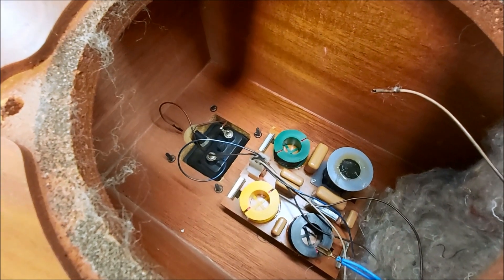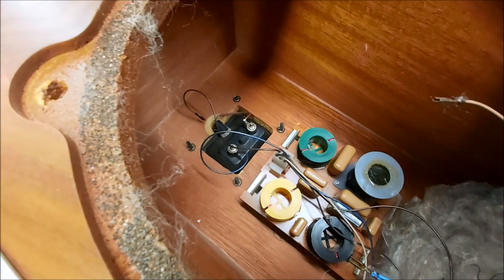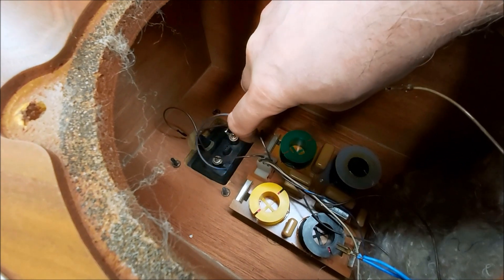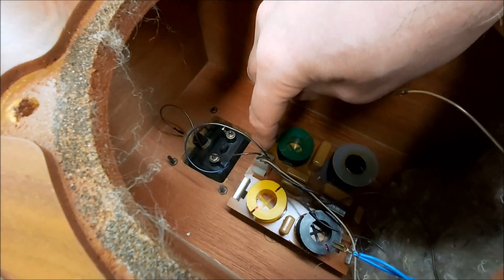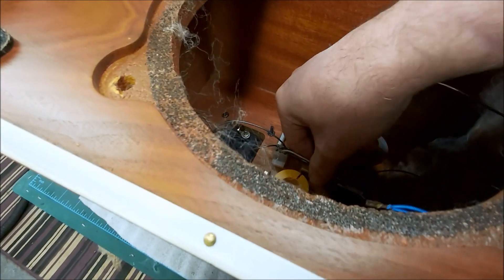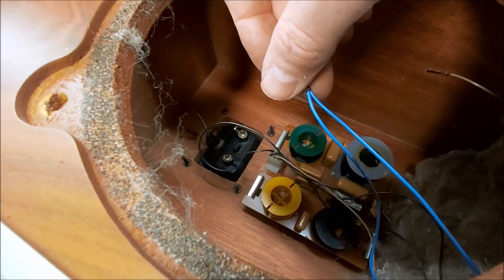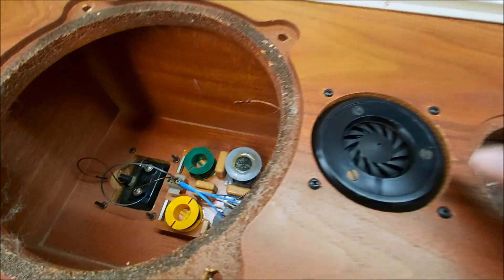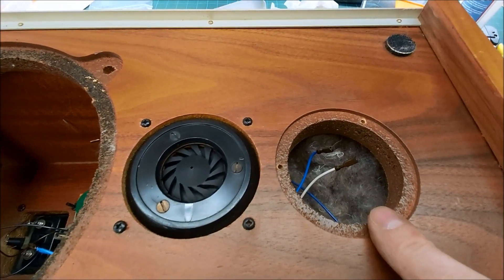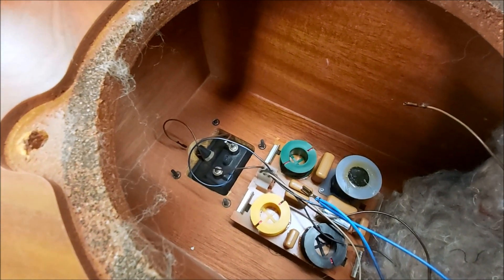Better still, get rid of them and solder the wires directly to the drivers if you can. It's a very small gauge wire as well. One thing BMW did with these is the negative for all the drivers is one looped wire — on the woofer negative we've got two blues, and they carry on to the HF1300 tweeter and finish up at the super tweeter at the top. Not ideal, but not the end of the world.